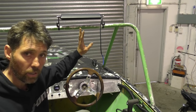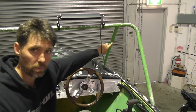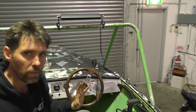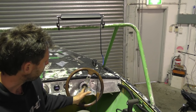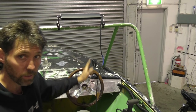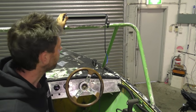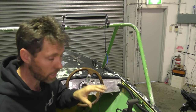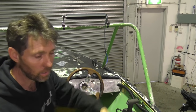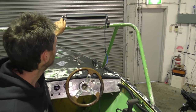I'm going to shuffle this light across a little bit to starboard. The reason is I want this wire to come down this pipe here, so the closer the light is to the pipe, the better. Aesthetically, I also want the centre of the helm and the centre of the lights to line up. I'll line those two points up and then lock the clamps down. That's feeling really secure — very happy that's not going to flop around even in hard chop.